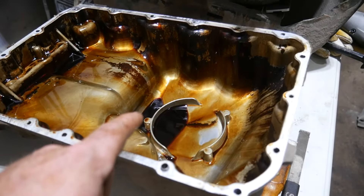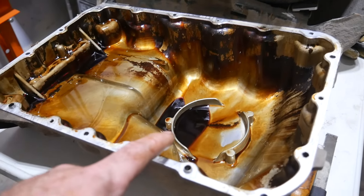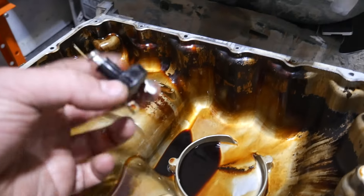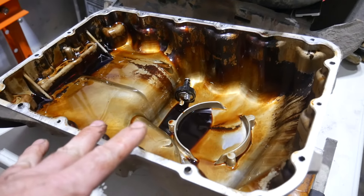On these Hondas, the drain plug is usually a 17mm, and it is kind of a common problem. It's aluminum, so you tighten it down too much one time and all of a sudden you're going righty-loosey. Got to be really careful with that. Unfortunately, after it's failed a couple of times, you've just got to put a pan on the thing.